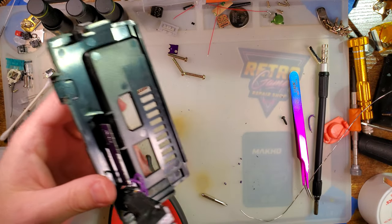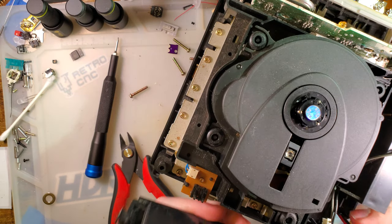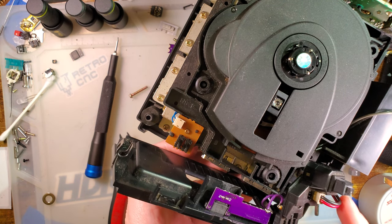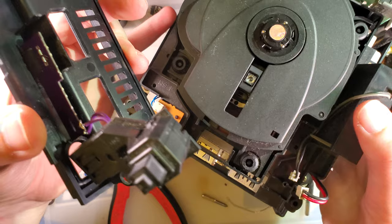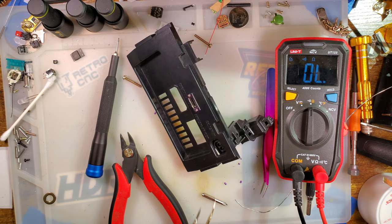But first, this message from our sponsor. No, I'm kidding. I want to double check the polarity. So on this board, you can tell because they thankfully color coded the wires. The back one is ground and the front one is 12 volt. Let's double check that, because I want to make sure I got the polarity right.